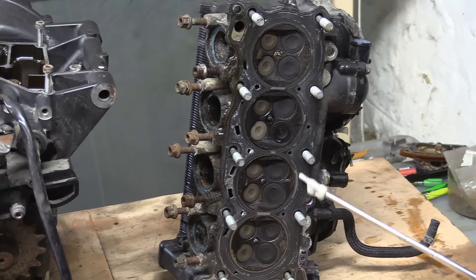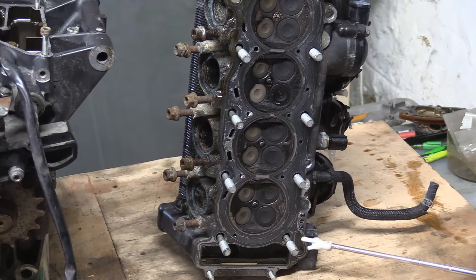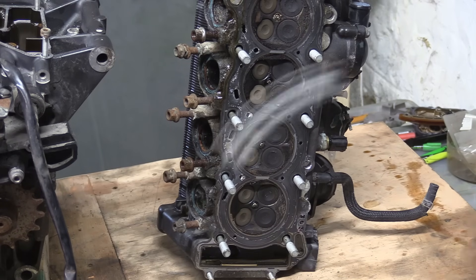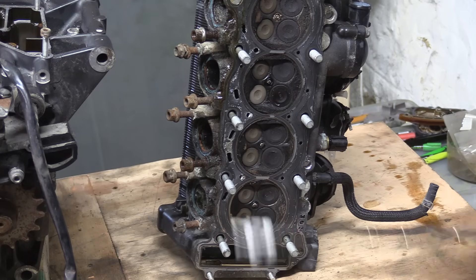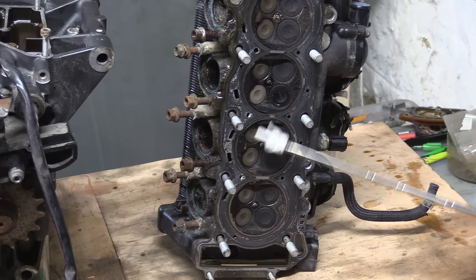On the exhaust side there are giant coolant passages, but on the intake side there are these little restrictors — tiny little things. There's the main gallery feed down here from the engine; that's oil that's circulated around the cooler, so it's cooler than the head and cools this side. There's also a big oil passage for the cam chain tensioner — heat can escape through anything that's circulating, even oil, giving some cooling effect. This cylinder has two main coolant passages plus two more.